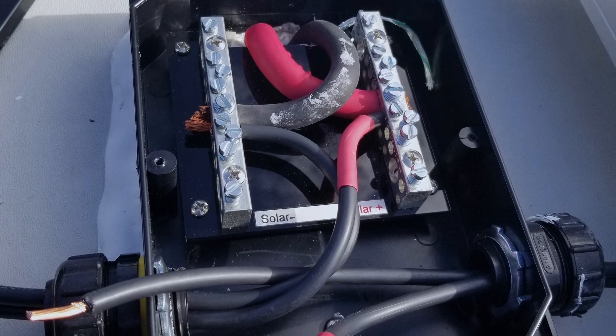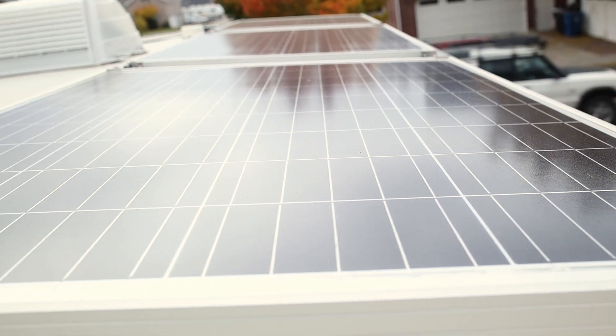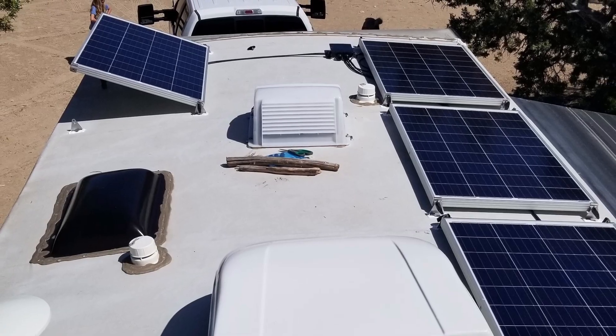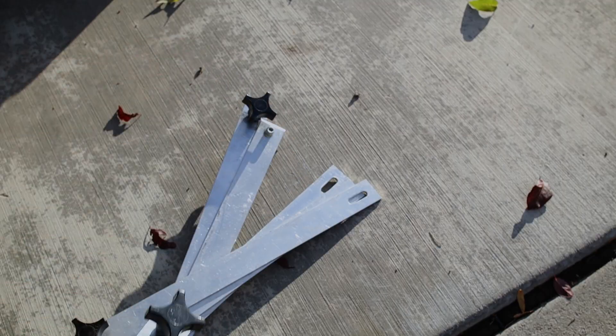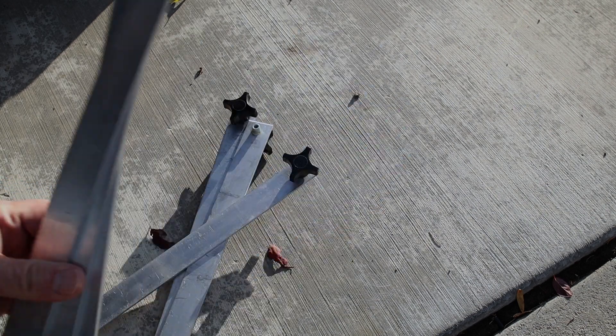No one likes drilling into the roof, but I marked it out and drilled my holes, put glue in there, and sealed the connections up with Dicor. The brackets are tilt-up brackets — I wanted those so that in the winter I could tilt the panels up to get enough sun for the camping environment. In practice over the last year I haven't had to use them; we've been parked in spots where the panels were on the right side and I didn't need to adjust them. You don't drive with those tilt brackets on, but I have them just in case.